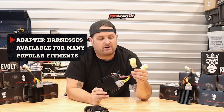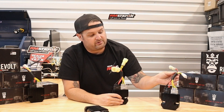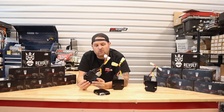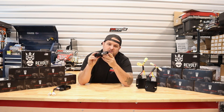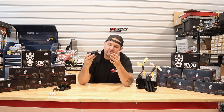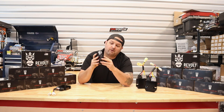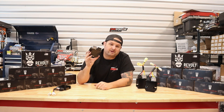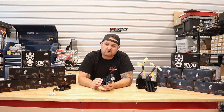You can check our website for all available adapter harnesses. We've got ones that give you a plug-and-play fitment to ATVs, motorcycles, and side-by-sides. We have here a Suzuki one, some Honda ATV fitments, and a Japanese plug-and-play fitment, possibly Triumph as well. These adapter harnesses make it really nice and easy to mount this in an original location and plug it in. We use fairly standardized connectors — the same type used by most OEM manufacturers. They're keyed and color-coded and will mean the same thing on any vehicle: the gray connector is always your stator input with three yellow wires, and the black connector is your battery output — inner terminal is battery positive, outer terminal is battery negative. It's a very simple five-wire hookup, compatible with any three-phase permanent magnet charging system, covering pretty much every modern ATV, motorcycle, side-by-side, outboard motor, snowmobile, and more.